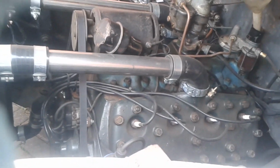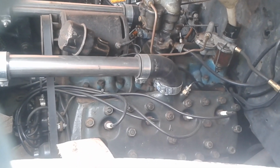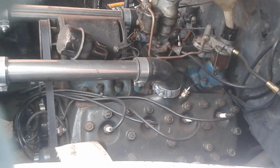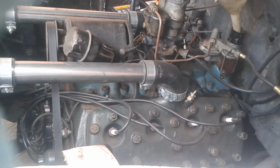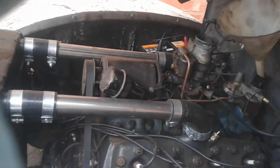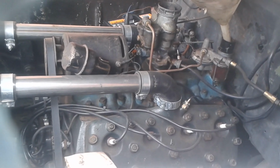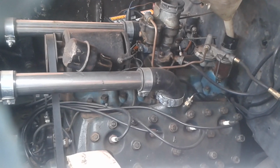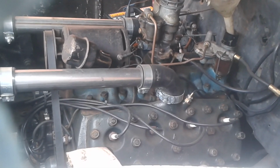I did a run the other day, and it was in the safe driving range but near the bottom. And I ran up the motorway, and it was okay on the motorway, but when I was doing some slow manoeuvres around some steep hills and sharp bends, it kept losing oil pressure around the bends on the hills. It was a hilly area. And again, I looked for a car spares place, couldn't see one, so I didn't put any oil in. And again, it was fine on the motorway when the revs were up.